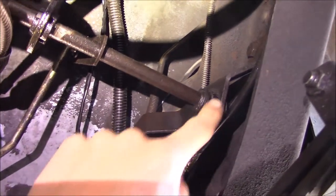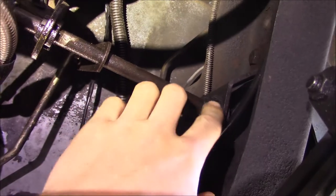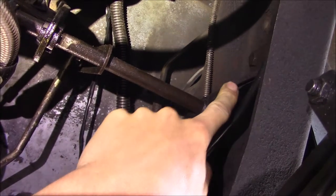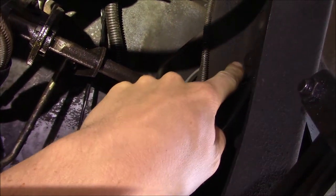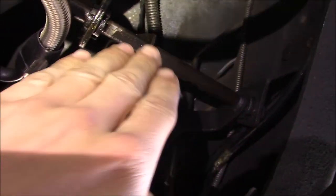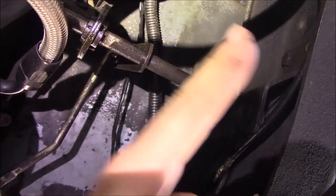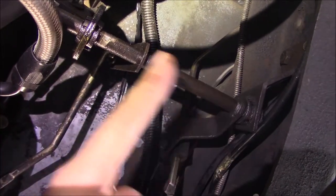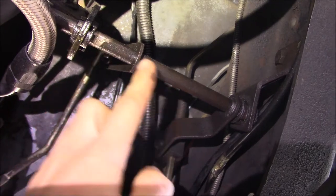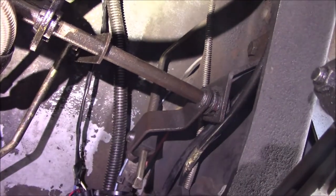This is essentially what I did. Since everything's moving back over an inch, I moved this bracket to some existing holes already in the frame so that this crossbar is at a nice 90 degree angle to the transmission, so that everything works smoothly and none of the bushings are too cockeyed one way or another.